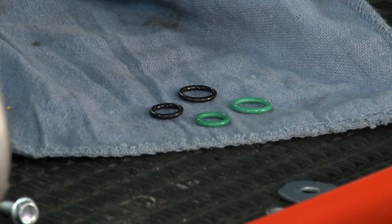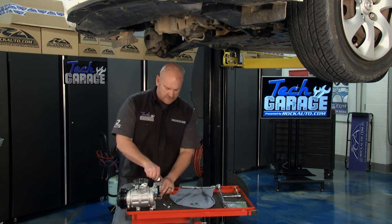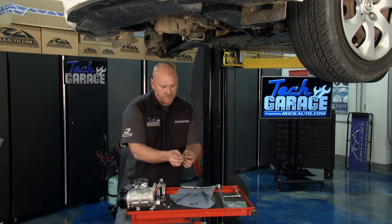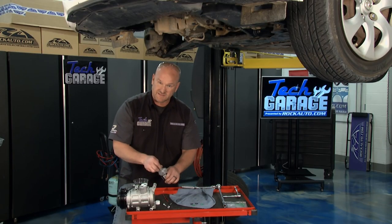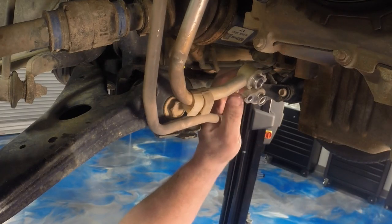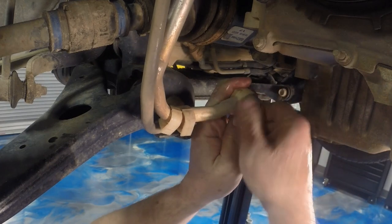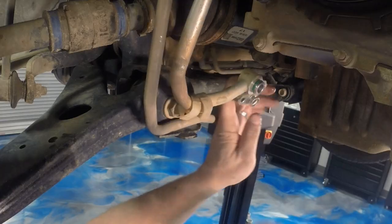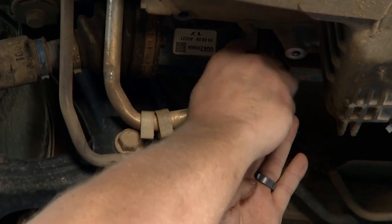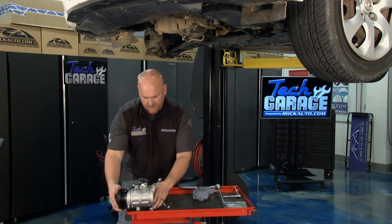The O-rings are critically important. You can do this whole repair, skip the O-rings, and you're going to have greater issues. Get clean hands, get the PAG oil, and take the new O-rings that came with the kit. Massage them between two fingers to get them lubed up — not only so they go on easier, but the PAG oil has a lot of conditioner in it that helps them seal and protect. Start with the big one and seat it down in the groove, then the smaller one. Take your time, make sure it's fully seated in the groove, and rotate it around to spread the oil.